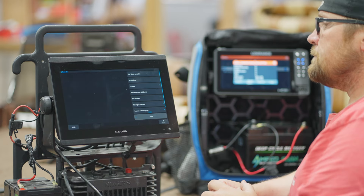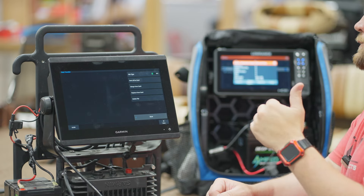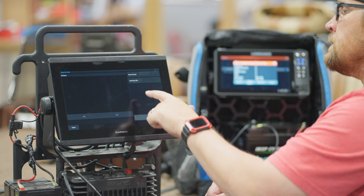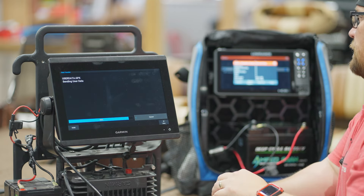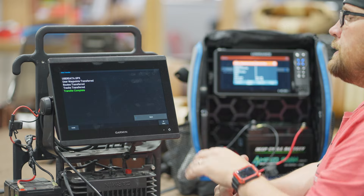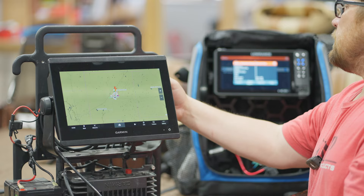So we're going to come down here to 'Where To,' and we're going to 'Manage User Data' > 'Data Transfer.' What we want to do is set the file type — make sure it's GPX — and then we want to 'Save All to Card.' We're going to click on that and save to card. It automatically names it 'userdata.gpx,' sending that file to the SD card. When it's done, it says transfer complete — tracks transferred, waypoints transferred, and routes transferred. So we've got them saved to our SD card from our Garmin unit.